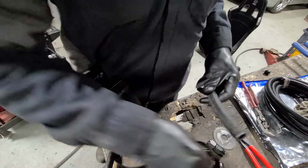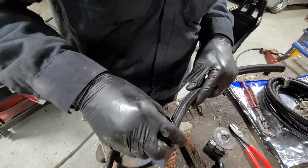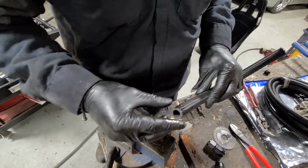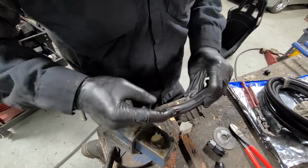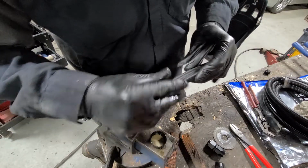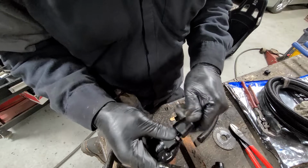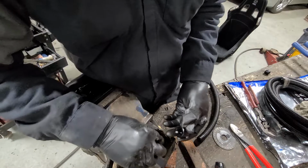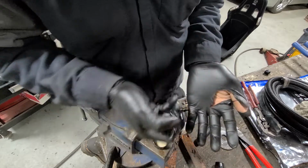So get your oil, lube up the hose. Lots of oil. You want to make sure this thing goes on easily. As you get to the bigger sizes and the stainless steel, the assembly process is basically the same, but with any of these you want to use a lot of oil. We'll do the straight one first. Go ahead, take the socket off. You're going to put the socket on first, so oil up everything on the socket. Oil the threads, let's pop it off.